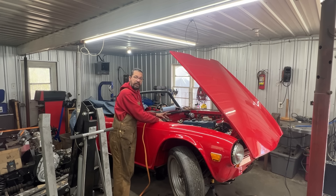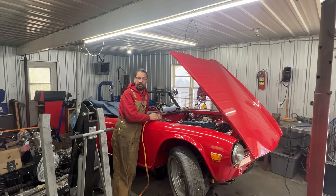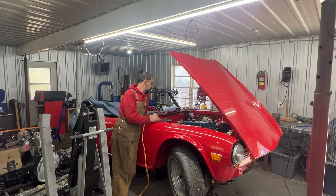There's one more issue we want to fix: the starter motor. We tried two different starter motors and they weren't working properly, then we found a rebuilt one that kind of works but still has a hard time cranking the engine — it stops at every firing stroke on every cylinder. That makes me think we have pretty high compression, so we should measure it. Maybe during a previous rebuild the head was shaved. We're going to buy a high torque starter to facilitate the cranking process.